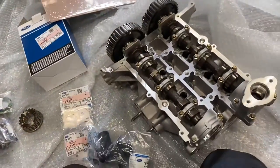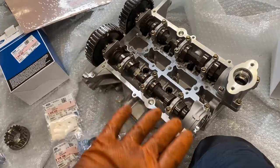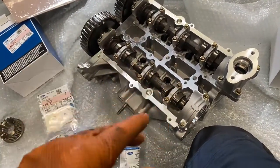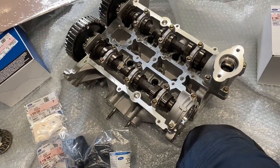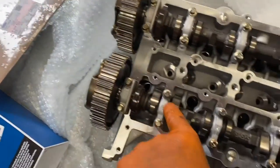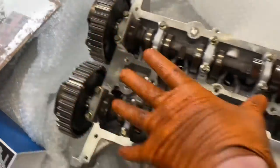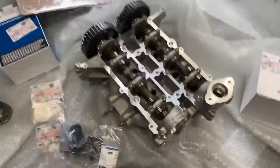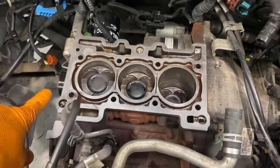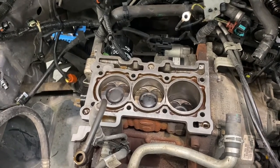Time for reassembly. I'll take the camshafts off again — they only send them up to shim them. They re-seated the valves and re-shimmed things, so the camshafts have to come off again for me to get my head bolts in. I can get most of them but can't reach them all with the camshaft in place. I've cleaned the block up, it's ready for the gasket and bits and pieces to go back in. Starting to close this thing down.